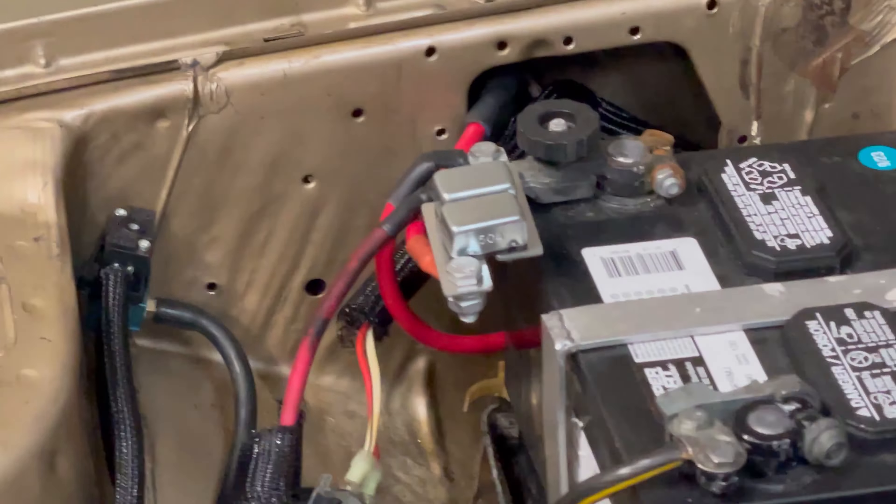I'm also blowing a fuse for my circuit board. Each fuse box has its own fused source voltage — at least that's how I understood it — but I failed to recognize that one of the power sources I'm using tees off and goes to two different things. I was overloading a circuit. I blew a fuse, thought it was a fluke, threw a 40-amp in. Then I started looking more into it and realized that one circuit I thought went straight to a single fuse block actually tees off to that fuse box plus the relay box I made.